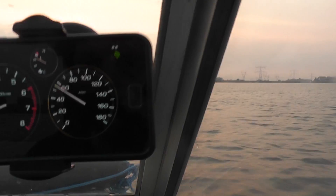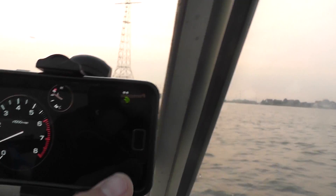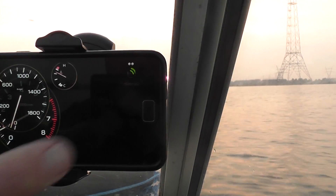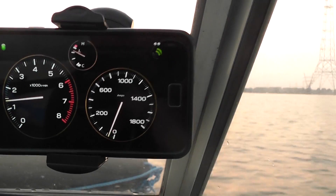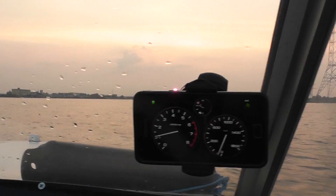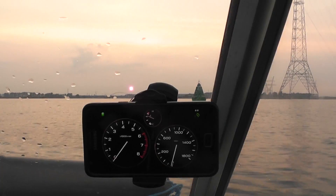So the problem we had here was my amps were falling off the scale. I believe if I remove the current gauge and add a Soliton 1 gauge and go for high amps — 150 to 1,800 — then unlock the dashboard, stick it over here, and lock it again. The cool thing is this will give me the low-end amps, just not that clearly, but it'll also give us our high-end amps. So now we're going to do zero cruise to full open and see what that is in amp draw on the pack versus amp draw on the motor.